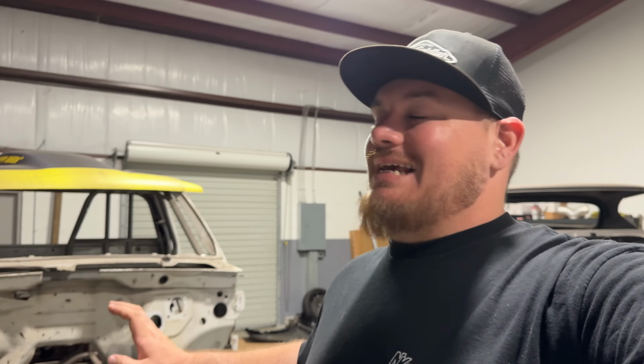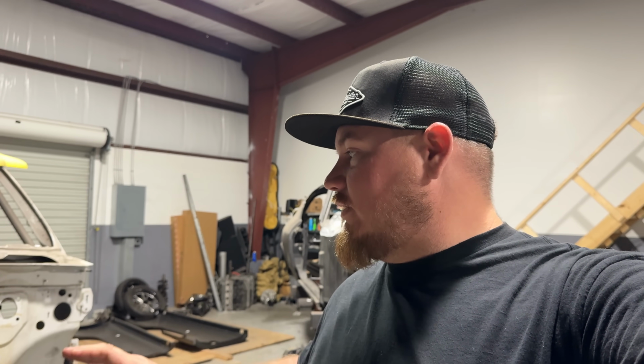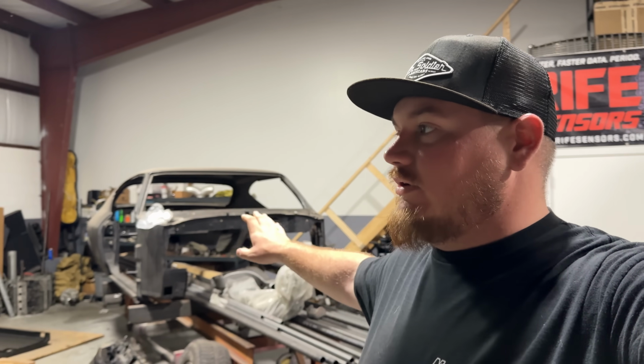I'm not sure exactly if I'm going to go big single or twins on this, but we're going to use the parts that we did have for Moonshine, and I'll get new stuff for that. That way this will get together a lot quicker than waiting for other parts. So the motor's being built. It'll be a billet crankshaft, aluminum rod, full skirt diamond piston. The head will probably be the limiting factor for now.